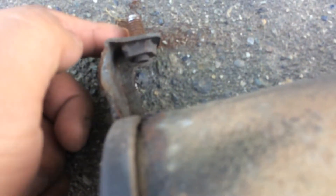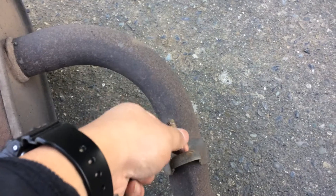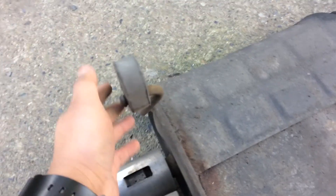Just a reminder for myself: there's a hinge here that broke off. I thought it was a bolt I could take out but it's not. It grabs onto the nearby piece, and there's another hinge right there so it's fine. I'm not going to use the little cylinder it comes with — removing it makes the exhaust a lot easier to take off later. The best way to remove those hangers is by dropping the whole exhaust and pushing them off the studs rather than pulling from above.